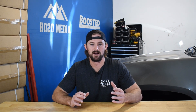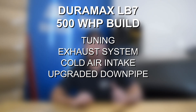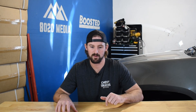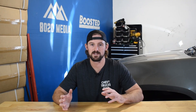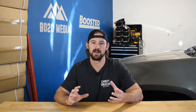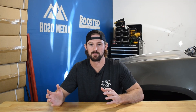So that covers our list of basic bolt-on modifications. With tuning, an exhaust system, a cold air intake, and maybe a downpipe, you should pretty easily be able to push over 500 wheel horsepower on the LB7 without any additional upgrades. I will note that if you're running on the most aggressive tune — whether it's the plus 225 horsepower PPE one or an aggressive EFI Live tune — you might run into some issues down the road with things like your transmission and the turbocharger once you start pushing up to that 500 wheel horsepower range.